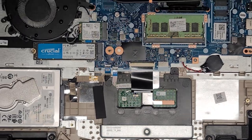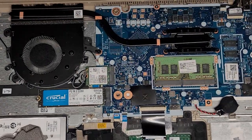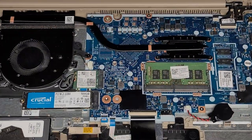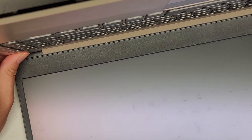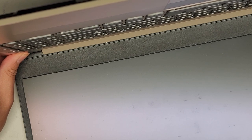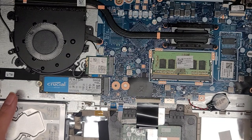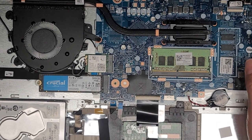Set the battery aside. I'm going to carefully open up the computer — the reason you want to do it slowly is that now the bottom cover is off, it's missing screws, so there's not as much leverage for the hinge. If you open and close it quickly, you can crack the plastic. Again, hold the power button for 15 seconds or longer — this is very important especially if you're doing anything with the screen cable or connectors, and it makes it safer if you accidentally drop something on the board.